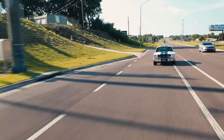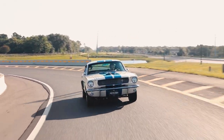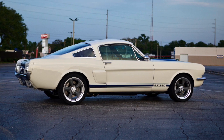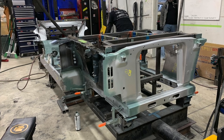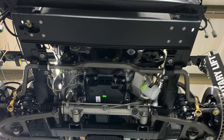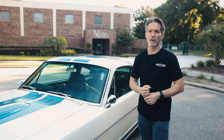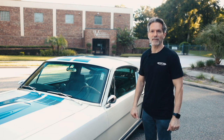That's really the reason. When you consider cars that were designed in the 60s in terms of their level of torsional rigidity versus a modern car, they were significantly inferior to modern cars. Polyurethane bonded glass is one of the reasons. Of the many things that we do at Rivology to improve torsional rigidity of the body, this is just one more thing, one more incremental step. But it really makes a significant difference and it's very well worth it. This is one more example of why at Rivology we don't build them like they used to.